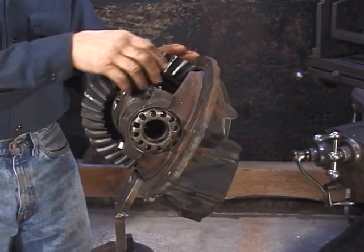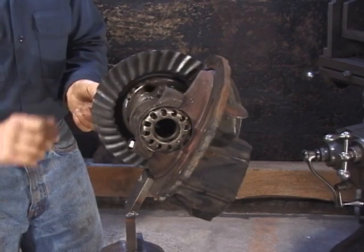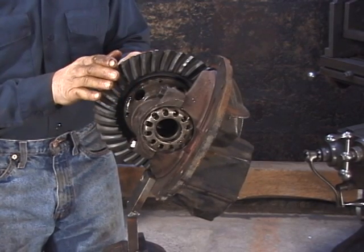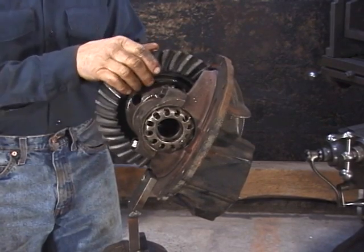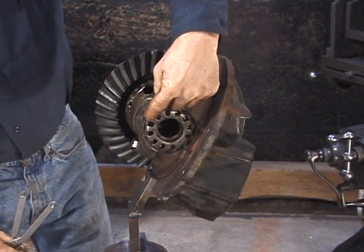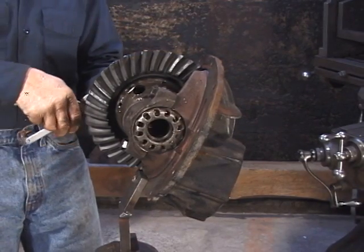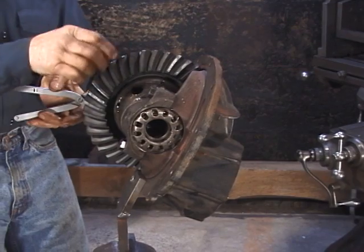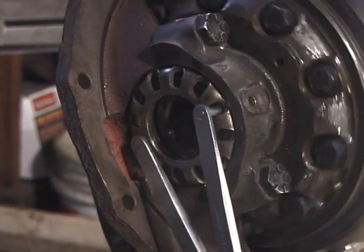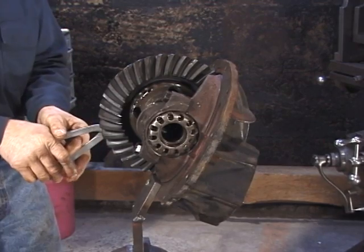With the pinion assembly removed, we can now just spin the ring gear. We only brought our bearings up finger tight, and as you can see, the gear is very free to spin. If you have used bearings, you're going to bring it up to zero lash and then just snug them very little. We have new bearings, so we actually want to set a little bit of drag on the bearings like we did on the pinion. To do that, we're going to work from one side. We've lined up one of the lock holes with the lock plate retaining area. On the opposite side, we're going to tighten up on our bearing while we spin the ring gear. As we continue to spin the ring gear and tighten up on the bearing, you'll notice that it doesn't want to spin quite as long when you release it—that means you've established zero lash.